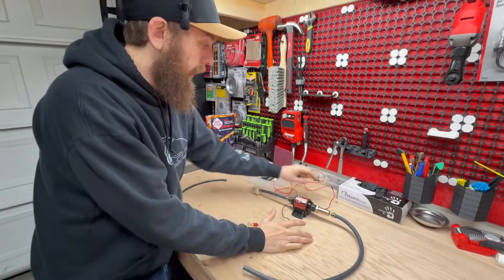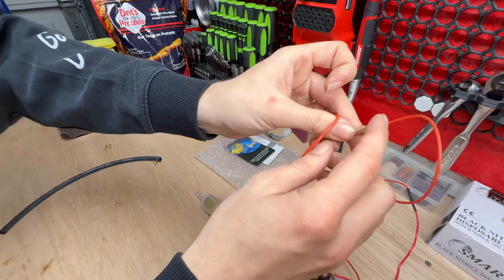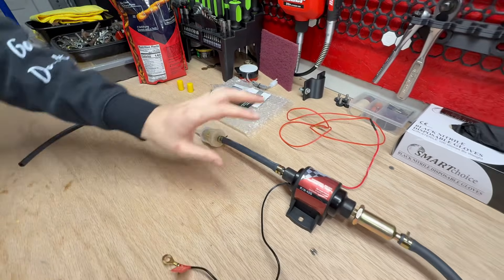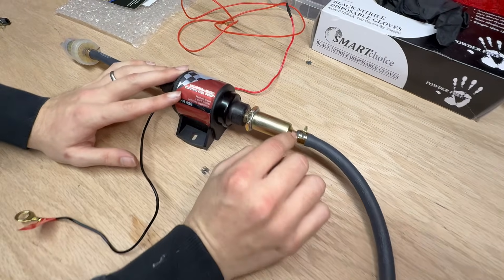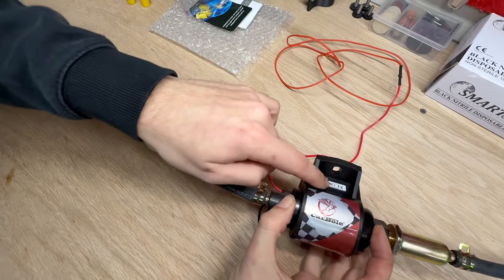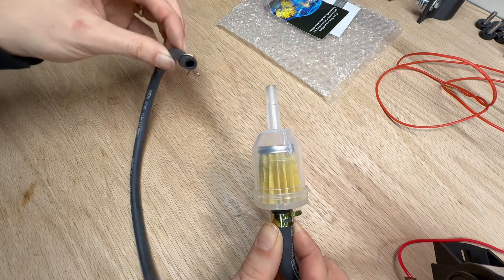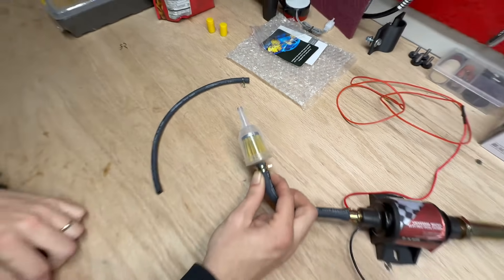Coming back to this, you can see the power wire I've extended and put a bullet connector on, as I did go onto the bike already and put a double bullet connector onto the constant power I want once the ignition is on. Going back to the fuel filter, I was able to shove quarter inch fuel line over the five-sixteenth inch end fitting, which will go into our fuel tank. On the other side, same quarter inch line goes into one of these step-down fuel filters, so I can shove a smaller eighth inch line onto the carburetor and knock out any fuel leaks.